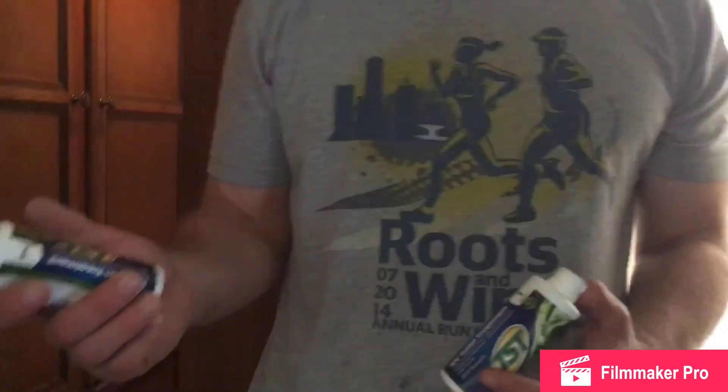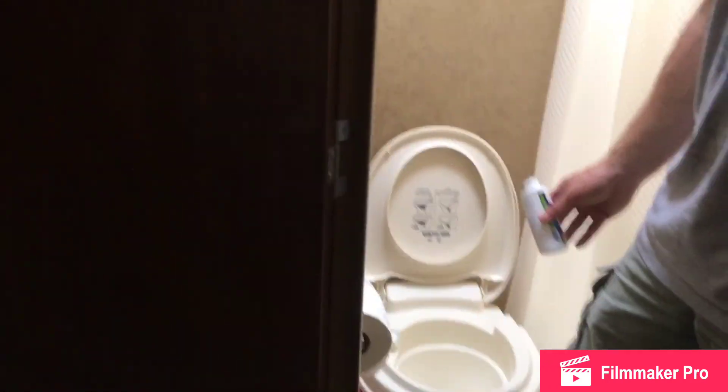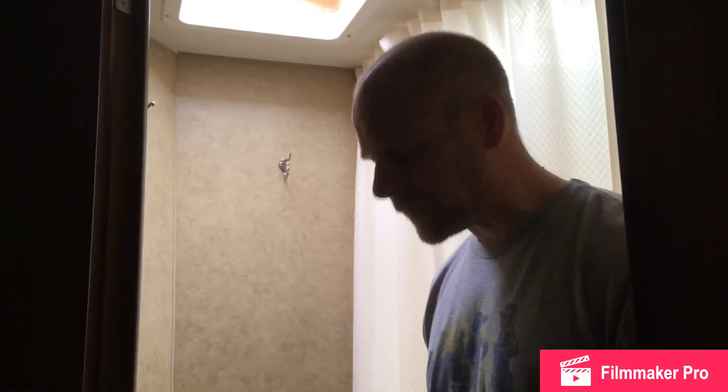Now I focus on the toilet. You need to make sure you're using an RV toilet treatment — we keep a stock of these under the sink in the storage area. When you start, pull out one of these packets and empty it into the toilet, then flush and run a good amount of water. It says about two liters — I recommend standing on the pedal for a good 30 seconds to let that water fill up and get a lot of movement.